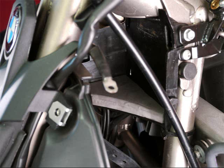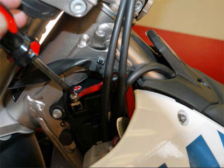The G450X has a truncated battery box floor, so we've trimmed to fit the diagonal shape, then applied the sticky side of the spacers to the battery box as shown below. The LFX batteries can bolt cable eyelets to either the top or front sides of the terminals. This time be sure to install the positive terminal cable first, then the negative to avoid short circuits.